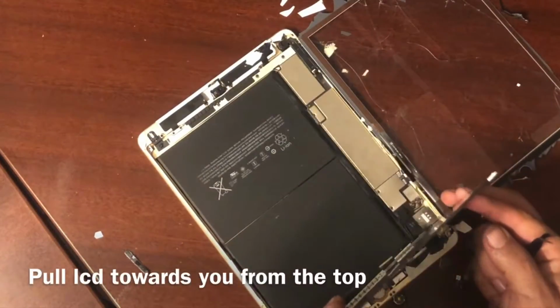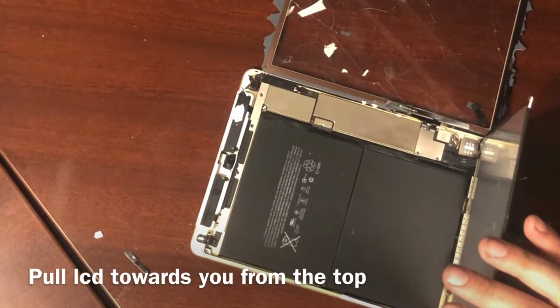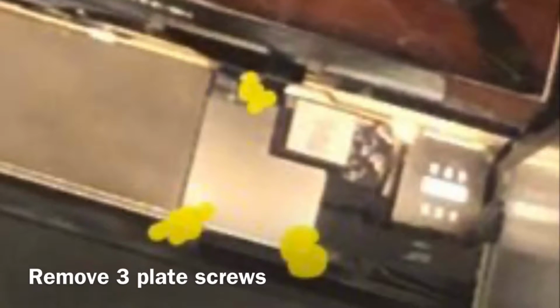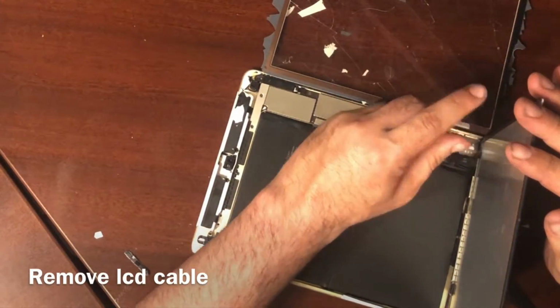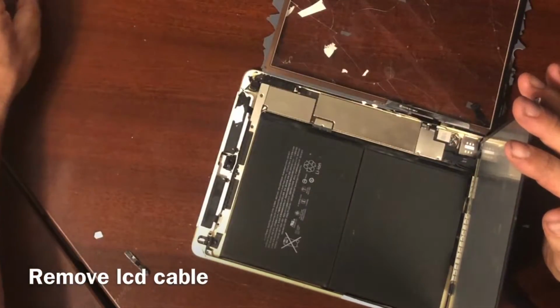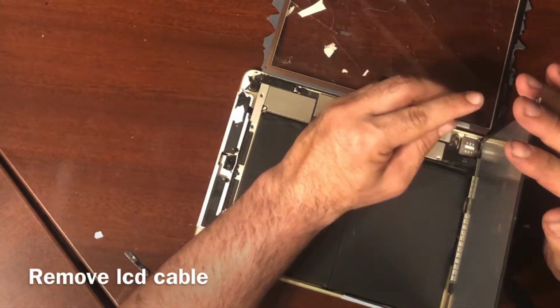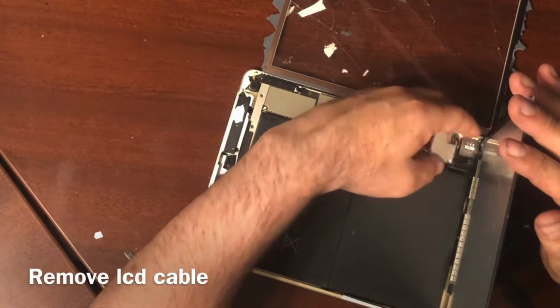But once we've got that, we want to pull the LCD towards ourselves, and then there's going to be a little plate at the back. This plate is going to be holding down your LCD and your digitizer. So you're going to want to take a small Phillips screwdriver. I'll try to leave a link in the description as well. That way when you order your screen, you can order one of these screwdrivers. You can get most of these screwdrivers at any electronics store, but it's just a small Phillips screwdriver.